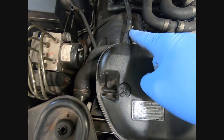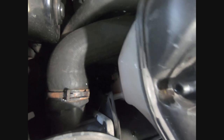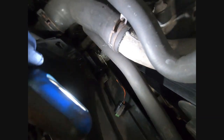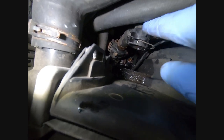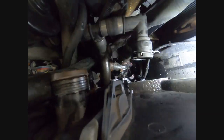The screws are out, the hoses are off - there's one there and one over here. You can see the pipe just there with a little metal clip. That is coolant coming out, and out comes the reservoir. There's a sensor on there - don't forget the little plug. There's the heater control valve. Now that I've lost all that coolant, I might as well undo this hose and the top hose for the water pump.